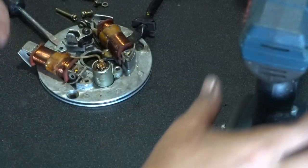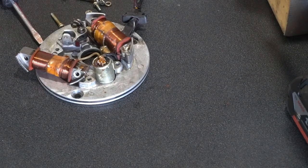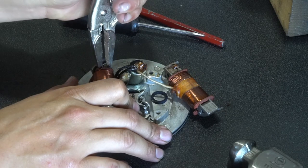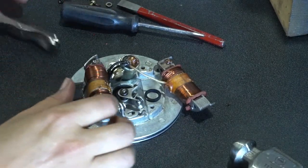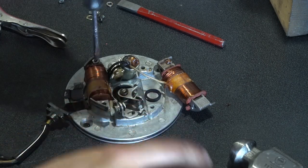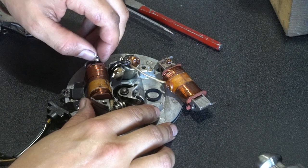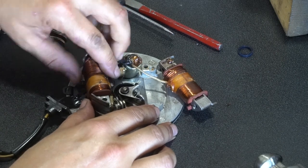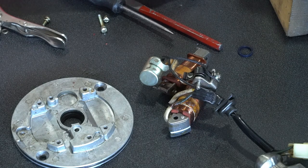So that one screw stripped out. What I ended up eventually doing here was getting a Dremel with a small cutting wheel and making a slit in it, and then I was able to use a flathead screwdriver to break it loose eventually. Or actually, I'm sorry, vice grips. So again, remember to keep and hold on to that little wire holder.